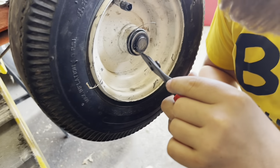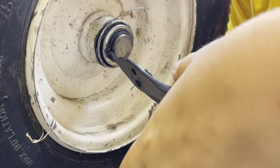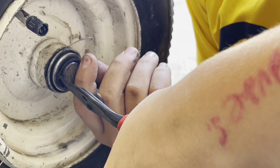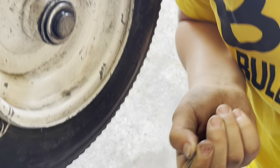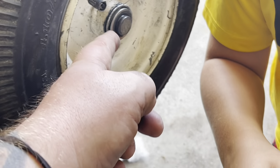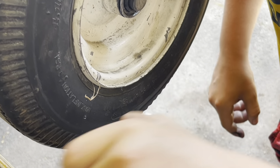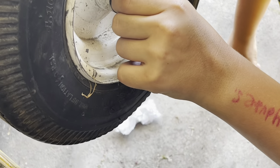The first thing he's got to do is get this wheel off. There's a circlip right there — he's never used circlip pliers before, so this might be interesting. There you go, you got it off! Good job. Set your circlip up here. That's a washer — get that washer off, and there might be another washer or that could be the bearing.